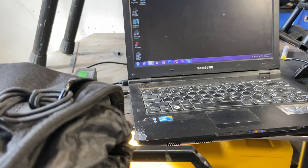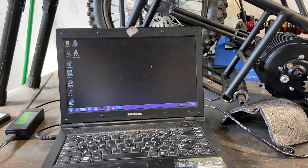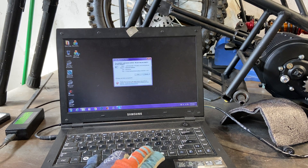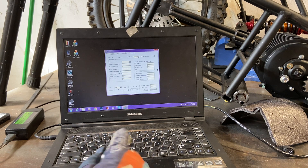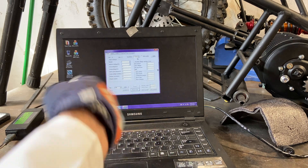Let's go into the computer now. So now it's hooked up. I'm going to go to this one for the 2SP program, open that up, and hit run. My bike is on the prolific port — everything's there. This says comm 6. If nothing comes up, you have to go through your prolific computer settings. My baud rate is 115,200 and I also matched it in the USB settings.